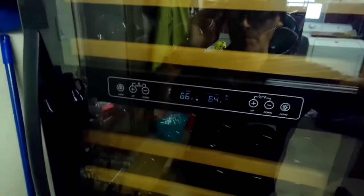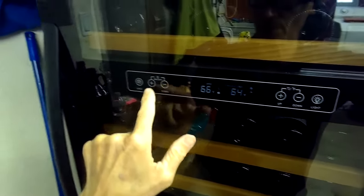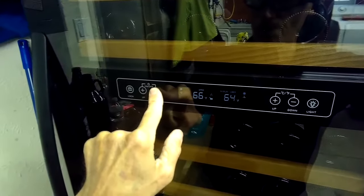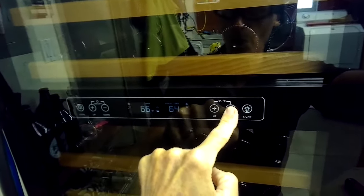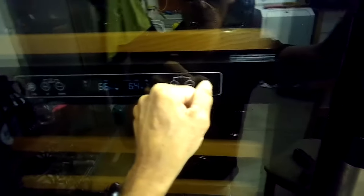One way you can tell if your wine fridge or wine cooler is working is if you feel at the bottom and there's warm air coming out — that's a sign the system is working. It's taking the heat out from where the wine is and cooling it down. If you just feel regular temperature air, it could be that the compressor is no longer firing up.